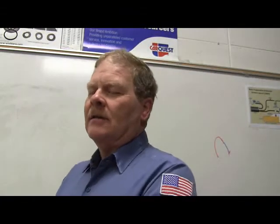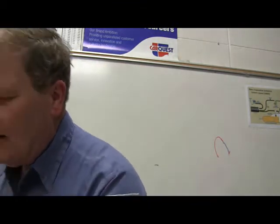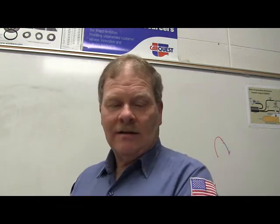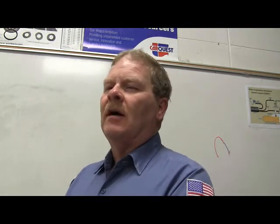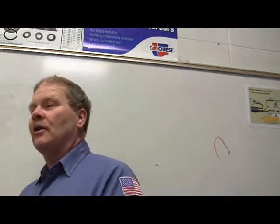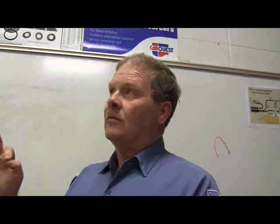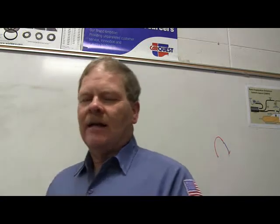But anyway, whenever something gets hot, and you guys must not have been exposed to any of that, you typically are going to see resistance on a piece of wire or something get higher. Now, listen to this term here and burn it in. You hear me? Positive temperature coefficient. That's what that is when something does what you expect. It gets more resistance as it gets hotter. That's positive temperature coefficient. Negative temperature coefficient is whenever you heat it up and the resistance goes down. And that's what our coolant temperature sensors and intake air temperature sensors and transmission oil temperature sensors, that's what they all do.